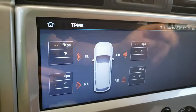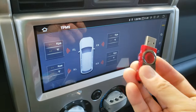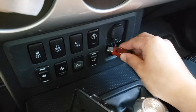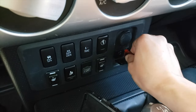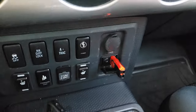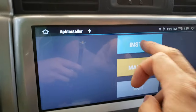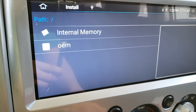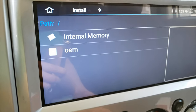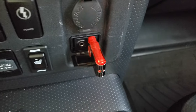So what I'm going to do is use the supplied USB which has the software on it, and just plug it in. I'm going to open up my second USB input to the head unit and see if I can install it through there. There's an APK installer — the app installer. I'm looking for this drive, which it's not reading right now. Something is definitely not right because that keeps blinking. It doesn't seem to be reading it.